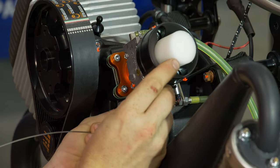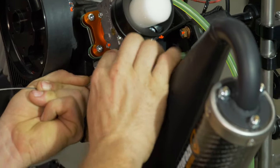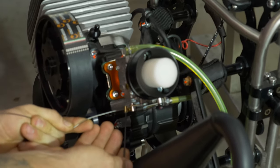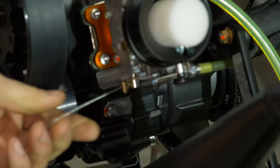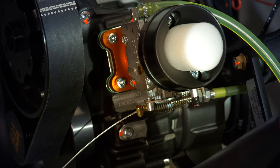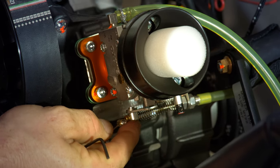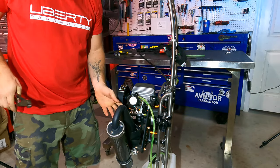Slide the barrel over and pull tight on the throttle cable. You're going to need to leave a little bit of slack — about an eighth of an inch. What I mean is when you're pulling tight on the throttle cable, you can see there's about an eighth inch of slack right there. What that does is help prevent the throttle cable from creating drag when you're moving your arm around — it can kind of pull on the throttle lever a little bit. If you leave about an eighth inch of slack, that'll eliminate 99% of that.